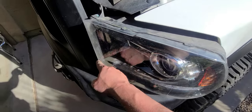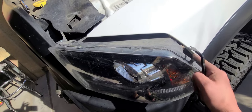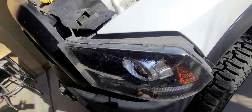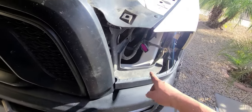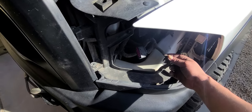Take that bolt out and that bolt out. Take your panel popper, put it right here in between the paint and that — you can put a little piece of tape there so you don't scratch — pull like that until you feel it pull forward, then slide it out. Same thing on this side: slide your screwdriver in there, pop that loose, pop the panel plug that hooks onto the back of the light, and you have removed your headlight.